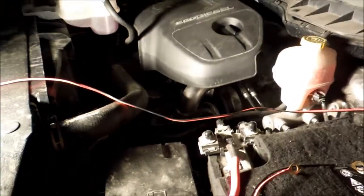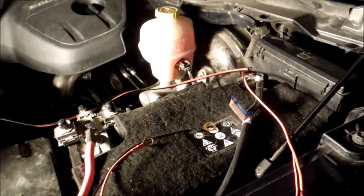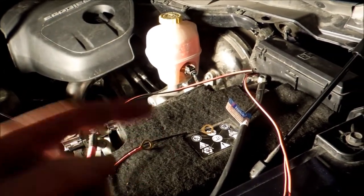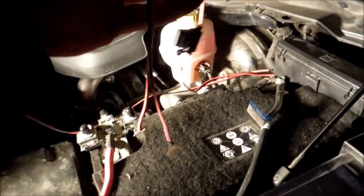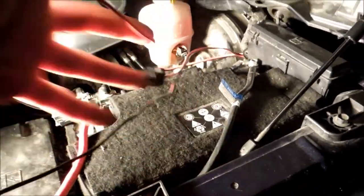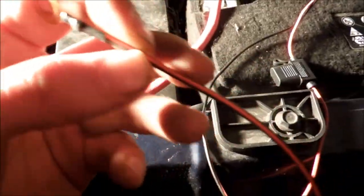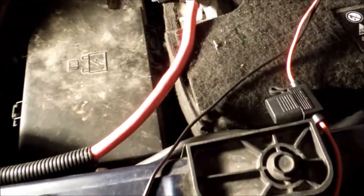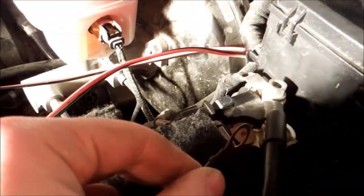Right now we're not going to wire loom them — we're going to rough wire everything, and then grab some loom tomorrow because the kit does not come with loom. If you don't know what split loom is, look it up online — just type in split loom or wire loom. Now the cool thing is: after I've put the switch where I want it, these are my wire leads. The one with the fuse is our battery lead. The one without the fuse — which has a red with black stripe or black with red stripe — the black one is going to go to your negative. We've got lots of room on that negative. Maybe we'll just put it right to the chassis — we'll decide.